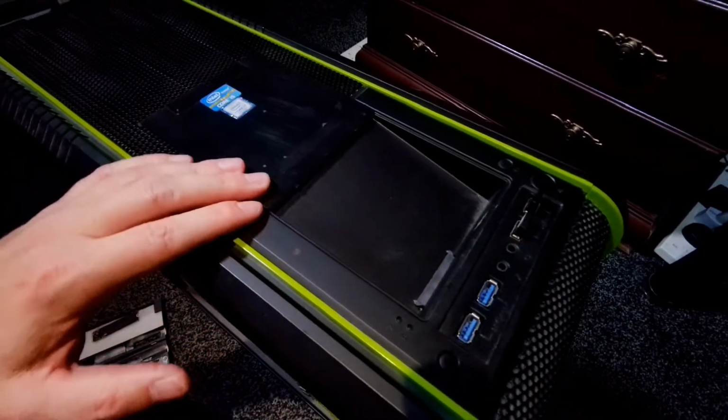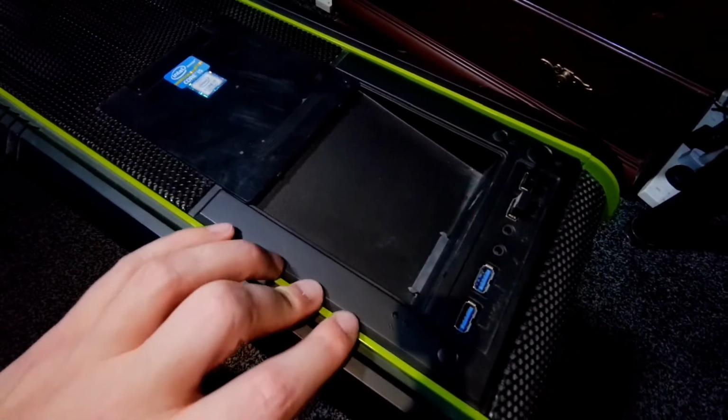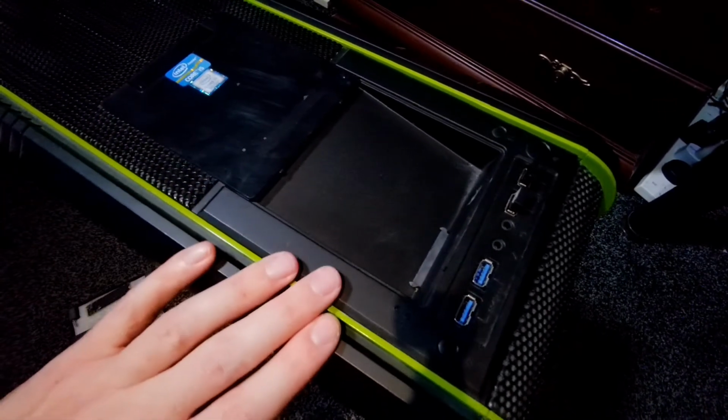Another SATA port is in here, which allows me to hot swap SSD drives. It's great for moving stuff and backing up, so I'd like to keep this operational. And since I'm using M.2 NVMe, some sacrifices have to be made, because adding this to my current motherboard means I will lose one of the SATA ports. This means my Blu-ray or optical drive is not going to be connected anymore, because I don't need it that much, and I'd rather have that HDD or SSD caddy on the top of my case than a drive that I don't really need.